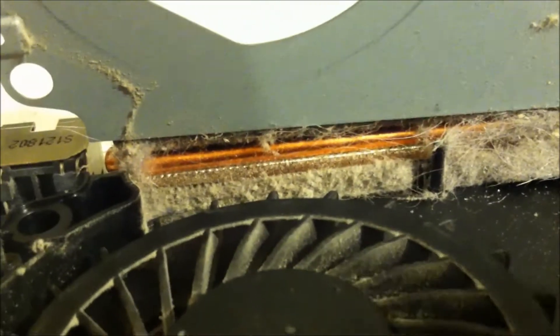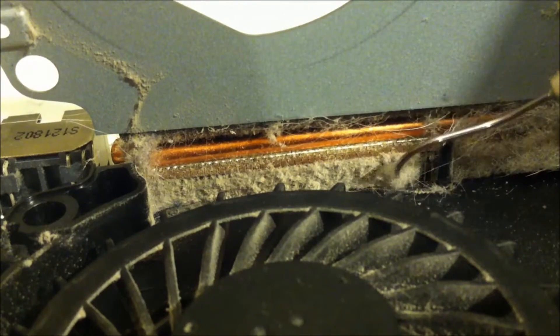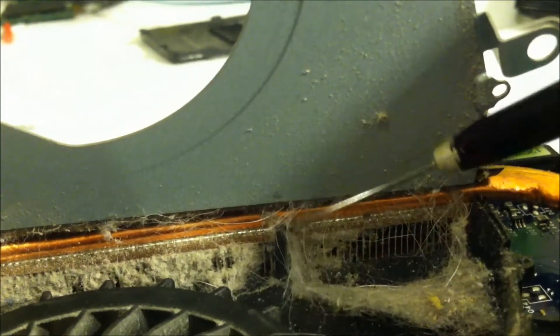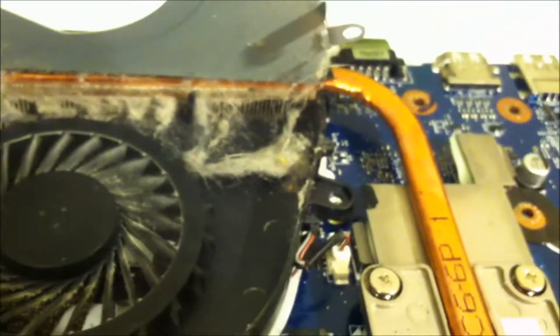The magic — the magic dust bunnies. I'm going to lift this up, not slide it, and here's your magic dust bunnies. This is lint. This is the equivalent of using your hair clothes dryer, pretty much. And this is why laptops overheat. Look at this one over here — complete blockage. So I'm going to get my brush out and scrape the lint out and assemble it back together — it should be good as new.